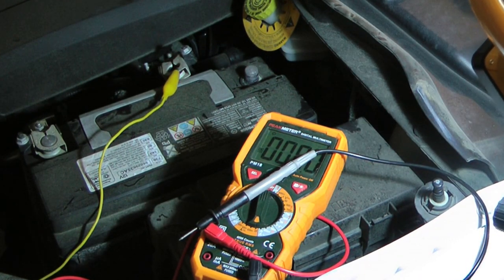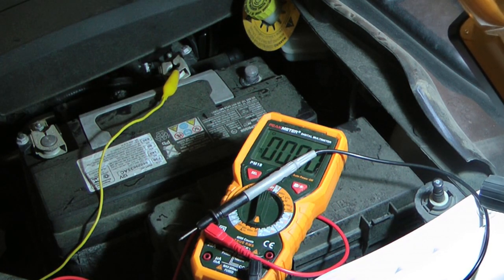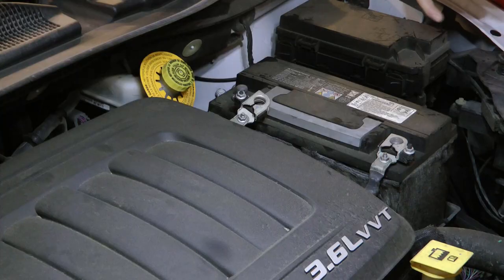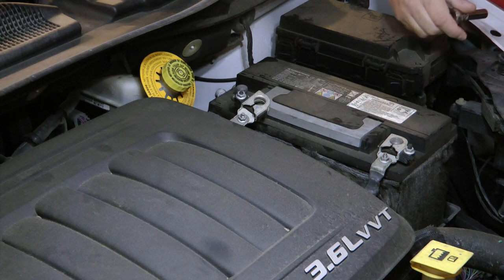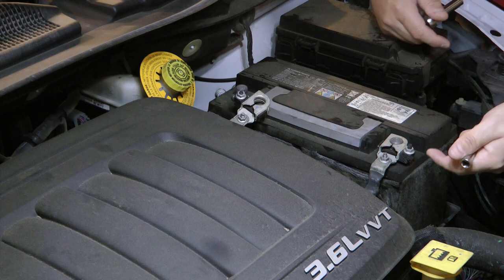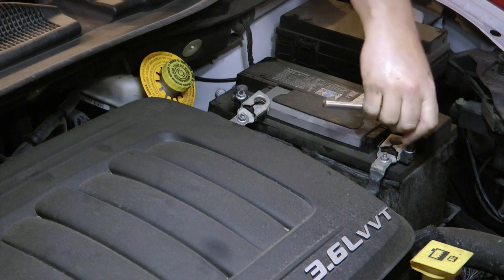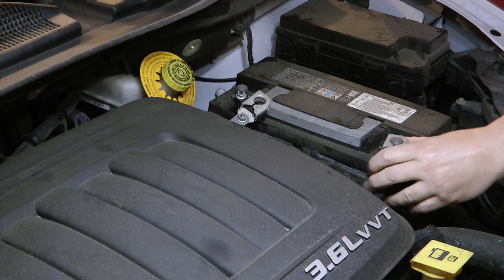With the data I've just showed you, we've determined it's just a bad battery. I've already removed the negative cable — I'll disconnect the positive cable, the little tie-down retainer, and pull the battery out. These Dodge Grand Caravan terminals are different than any I've worked with before. Typically they bolt on the side and spread apart; these come from the top and are 10 millimeter — you have to loosen them quite a bit before they start moving.